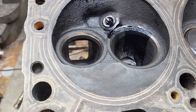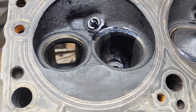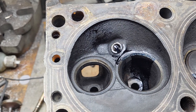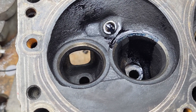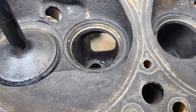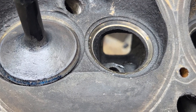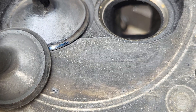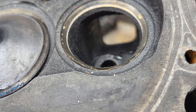Okay guys, this is going to be our mission impossible 318 manifold testing. Rob was nice enough to dig these off an old 318 he had. I have to admit it's probably the dirtiest and most worn out head I've seen in a very long time. How worn out is it? You can see that edge right there on that seat - that is from actually wearing into that ridge on the exhaust valve. Why is it so worn out?